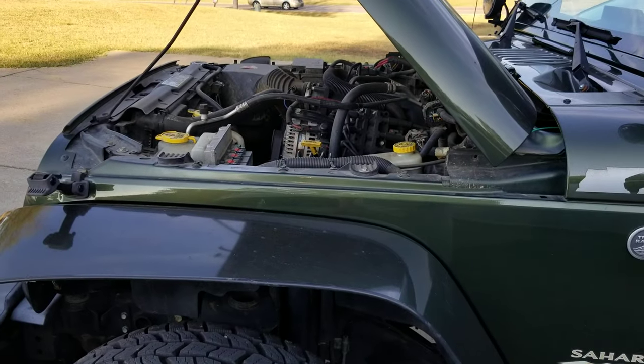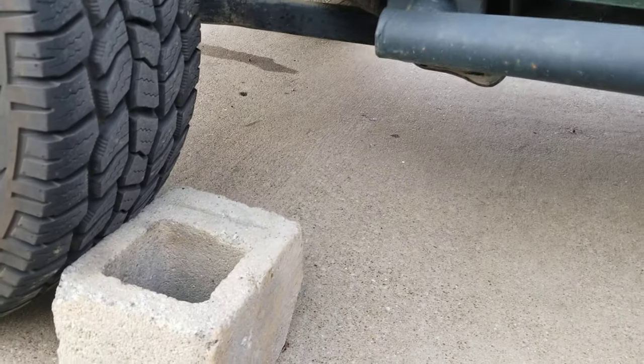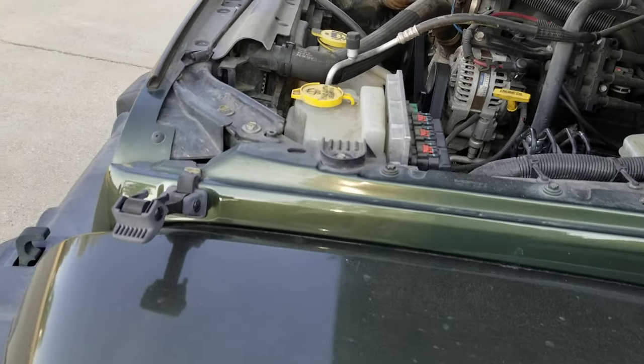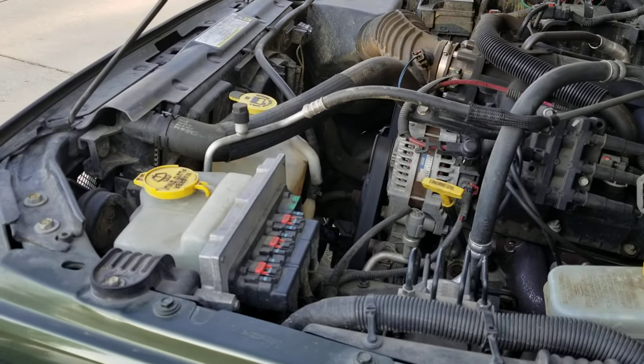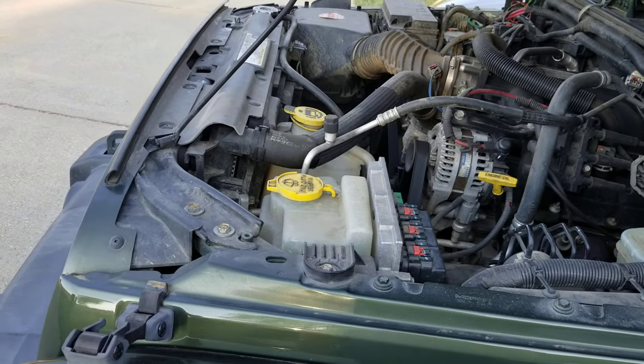So I got into it and started troubleshooting a little bit. I'm not leaking anything other than a small oil spot where I've refilled some stuff, but nothing leaking from the water pump. My fan's been kicking on and running just fine — it's putting out a proper amount of thrust to pull air through the radiator.